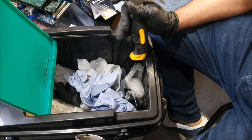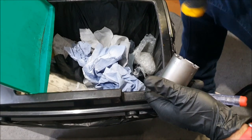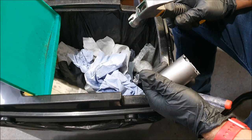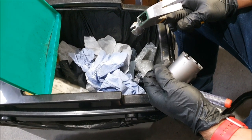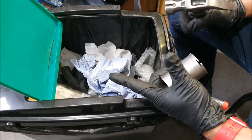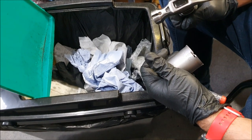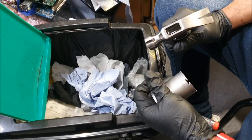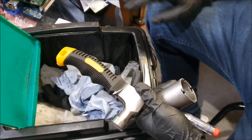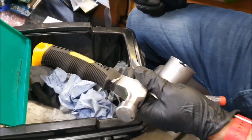Then I've got to work on the swirl flaps, the famous swirl flaps. They're coming out, basically. I'll be taking them out, considering that the inlet manifold was brand new and I fitted it myself. I think I bought it in 2014. We're in 2020, so it's six years. But the mileage, when I replaced it, was around 90,000, and it's done 111,000. So it's only 21,000, and how stupid it is that the seals have started leaking from the side. So I'm going to get rid of it totally. I've got the blanking plugs here. I've bought them off eBay, dead cheap. That's going to get done.